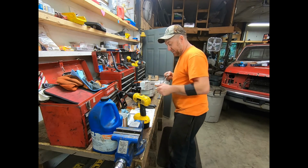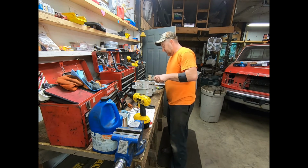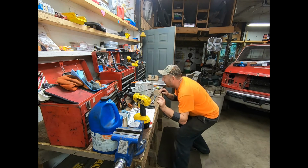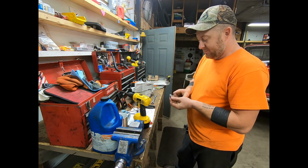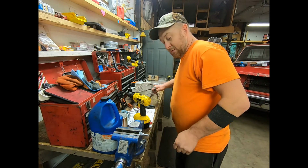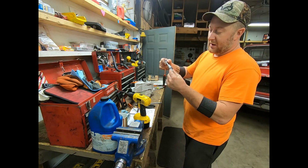Now, back to the wrenches. I'm going to take the bottom one and the top one and loosen them off of each other again, just like that. And then I'm going to loosen this one off the shoulder, just like that. It feels like you got a little bit of a burr there, so you got to be careful. Apparently, it looks like it's the stud. Damn it. Stud took a little damage, a little thread booger, but not the end of the world. And hopefully, this is translating pretty good here. Get it to where they both line up, straight line, that way the socket goes over both of them.